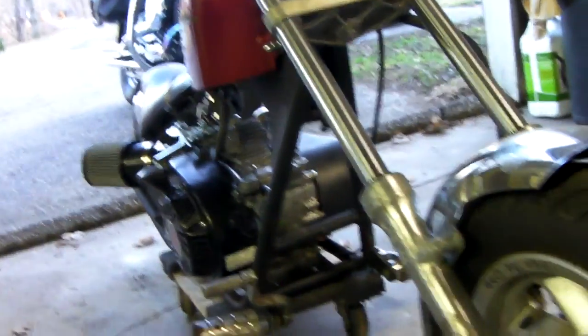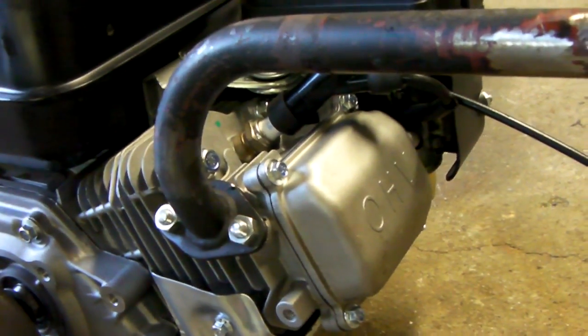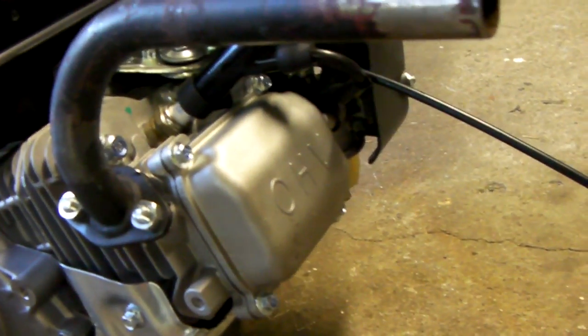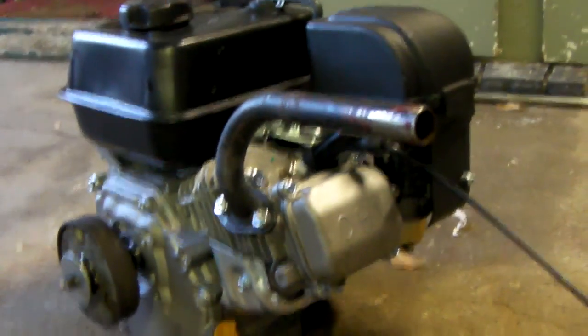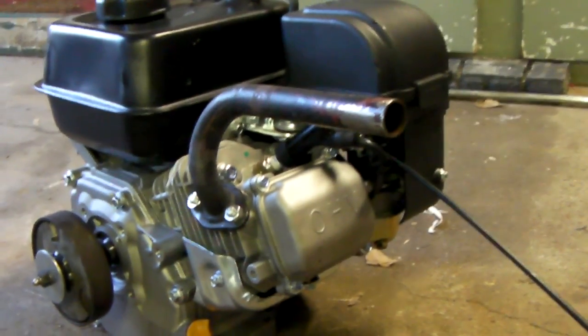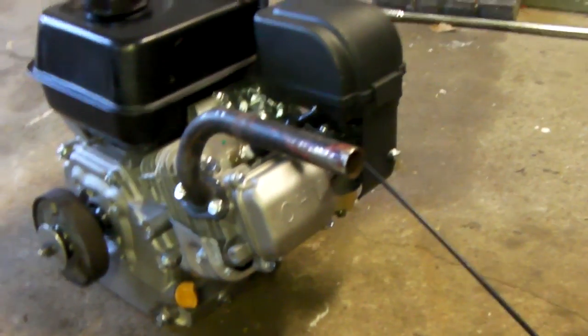When I compare the valve spring installation on the hemi style versus the old first-gen, I'd say the valve springs are a lot easier to do on this one — all I did was plop the springs out, plop them in, checked the valve lash, it was exactly where it was, put it back together. Didn't have to mess with the valve lash at all. You can hear it running — it sounds good. Going to do the carb jet kit next and then this thing goes back in the track bike. Thanks for watching, and if you've got any questions or comments, let me know!